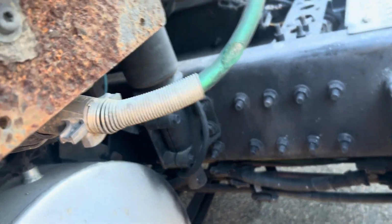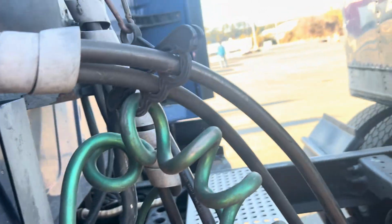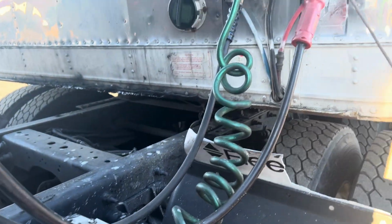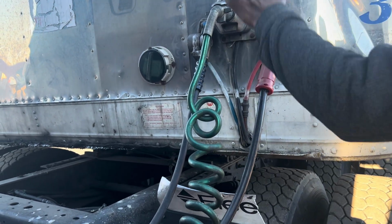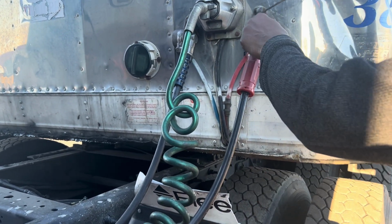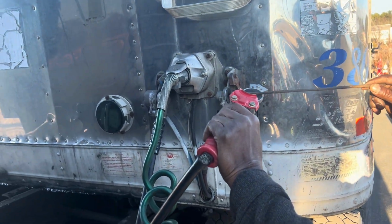They're not loose. Then I'll check all my hoses. They are connected from the tractor on this side to the trailer on this side. Okay, they are mounted and secured to the vehicle, not been broken or cracked. This red one is called the emergency hose. It's responsible for the emergency brake, and it has a glad hand inside. This rubber seal is called the glad hand. Mounted and secured to the vehicle, not been broken or cracked.